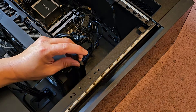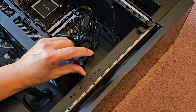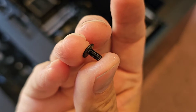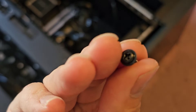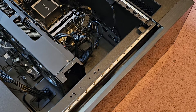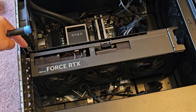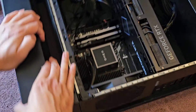Keep the screws in order because they are different size, shape, and length — you can damage something if you mix them up, so it's very important to keep them in order. The screws at the bottom are flat like this and about that length. The other six have a rounded top. Those six are actually all the same, and then the one at the very top holding the GPU is different because it's not going into that bracket.